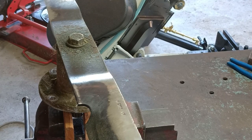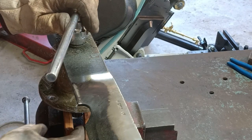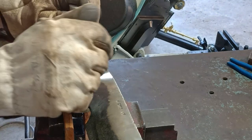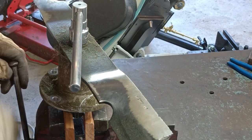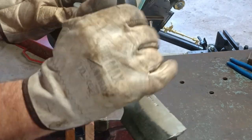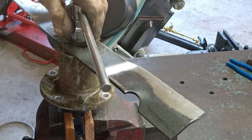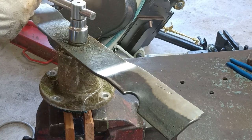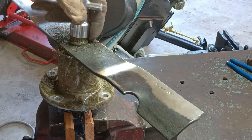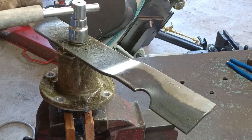Okay, just got to take the blade off the shaft. Yeah, there's no spanner flats on the shaft, poor design in my view. But to stop damaging the spline on the other end of it, two bits of hardwood in there. And maybe we need to crank it up a bit more. Easier said than done, isn't it? Much easier said than done. Alright. Extension bar. Gotcha.